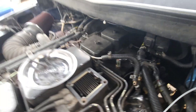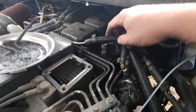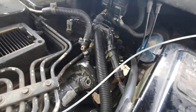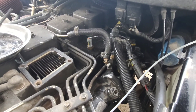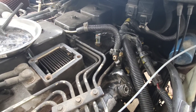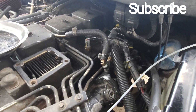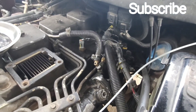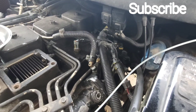Hey guys, got her all back set up and installed. This line you'll have to bend a little bit so you don't get any kinks in the hose. That's your boost elbow install — pretty easy stuff. Get more psi out of your HX35 turbo; it's one of the essential things I do whenever I get a 12 valve truck.